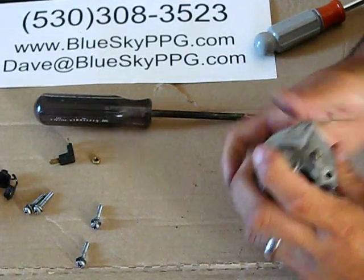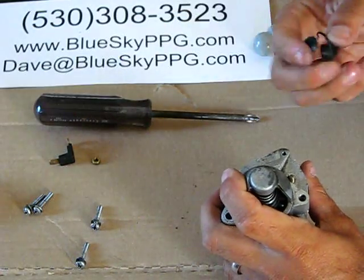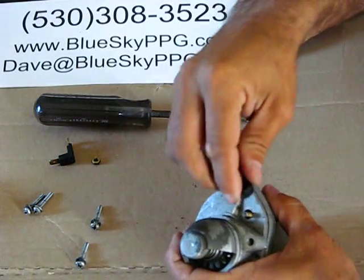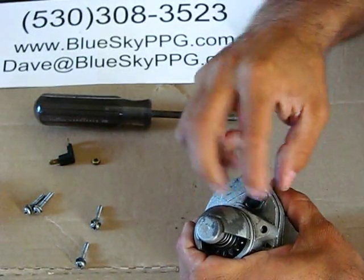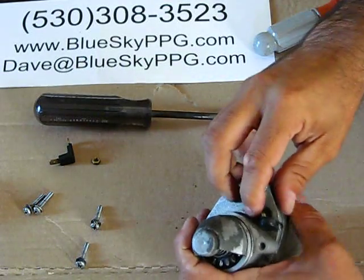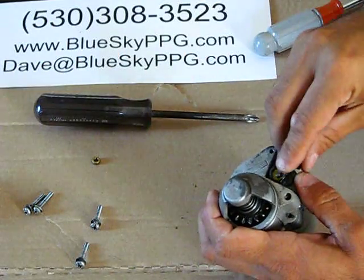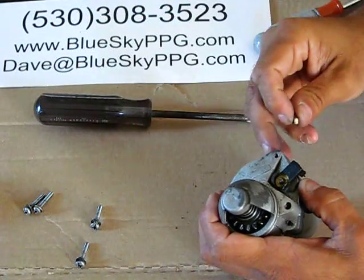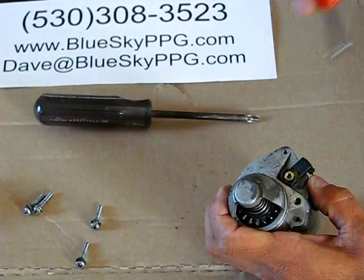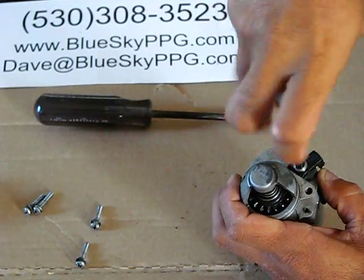Once you've got it seated, before I tighten anything else up, you'll notice that our reverse order is different than how we assembled it. And the reason why is because of this little booger right here, the positive. So I'll take my little plastic guard, and if I don't have anything tight, I'll be able to put the plastic guard on much, much easier. And then take my positive post, slide that over the top. If you have the gold flat washer, it goes up on top. And then finally your nut, the gold nut goes up over the top. Okay, tighten that down.